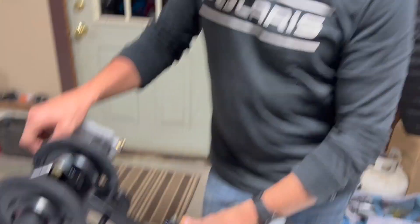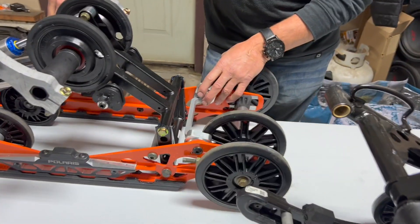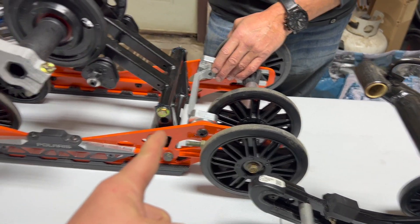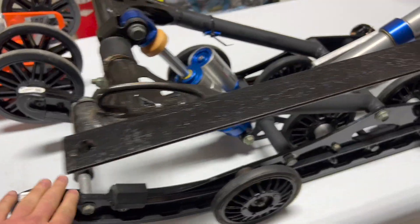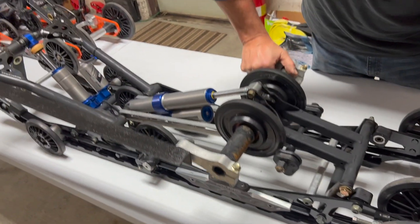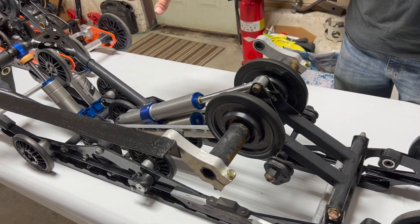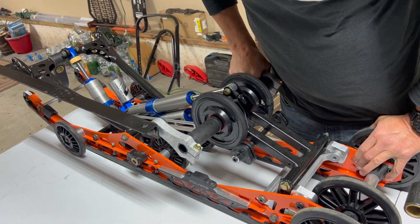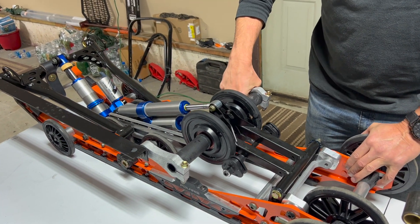Least amount of transfer, and that kind of force is actually using not only the two springs but also the third spring when that happens. So it is really not going to want to transfer. The idea is when you hit the throttle on a turbo going across the lake, you're not riding the tail of the sled. On the low setting you guys saw nothing really happened. On setting four, it hits boom - it's there immediately and starts using three springs, so it is not going to want to squat. The question is what that's going to do in the trail when ripping through bumps.